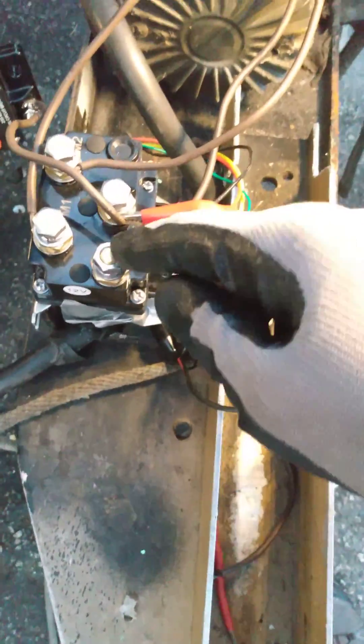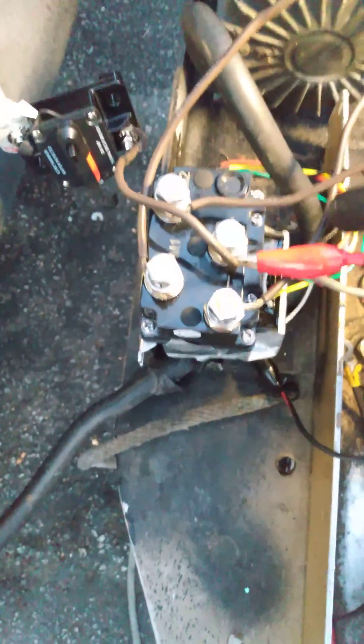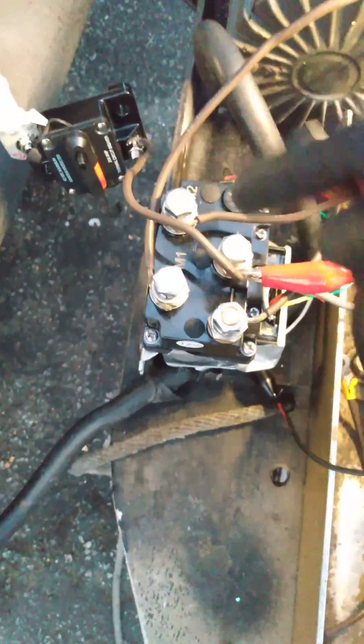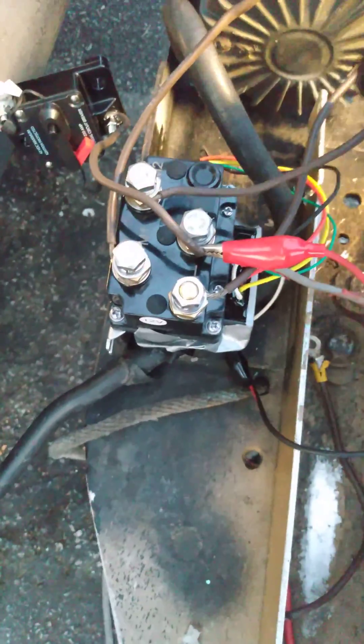This particular brand has a lot of problems with the wiring, but this wire right here is the negative — you can see the negative — and then you can follow the positive wire. M2 goes up here on this side, and M1 is this one right here, which makes it pretty easy to figure out. This center here is grounded to the battery ground.